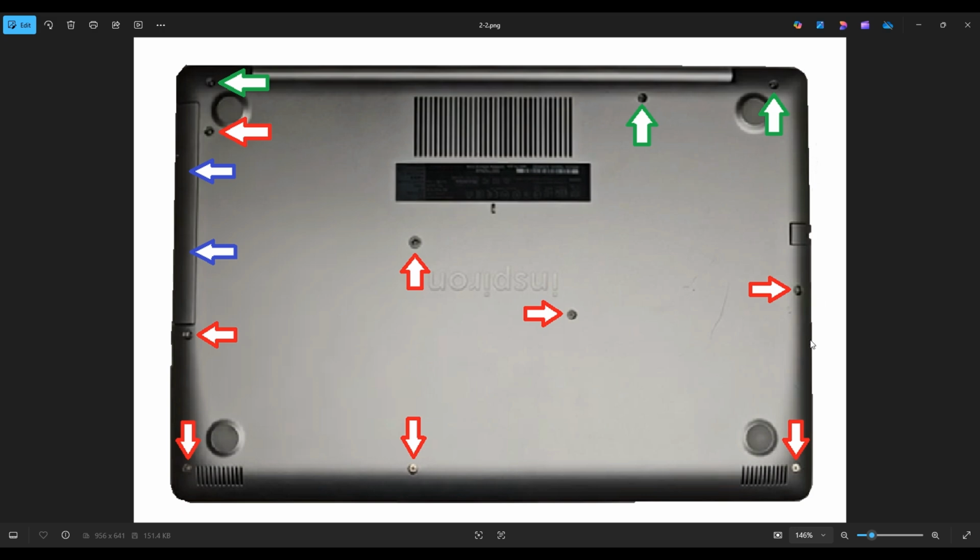After taking all those screws out, you'll take a small flat pry tool and you'll go across the seam of the bottom case and pry it apart from your palm rest. Now be very careful over here, because once you remove that CD drive, the piece of plastic that's left screwed down to the computer is very, very thin, and those are easily broken.